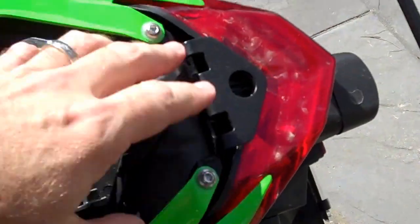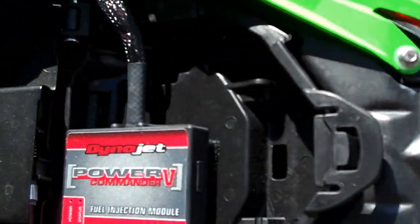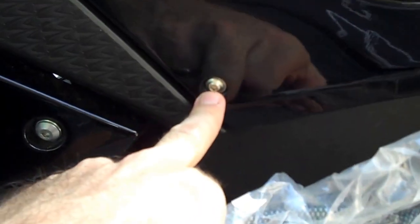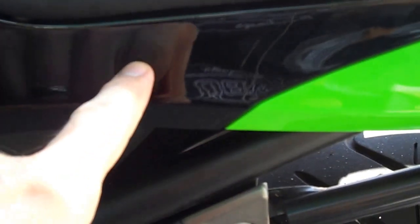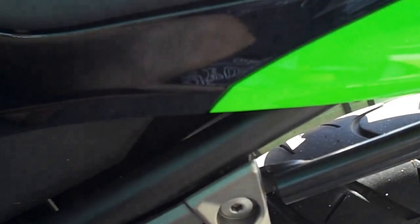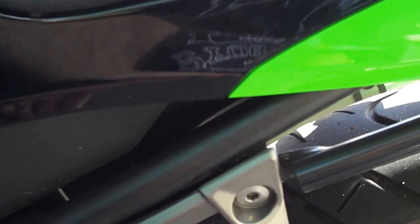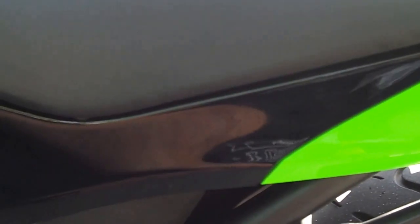It's not hard to wire it up. There's just the anode and cathode wires that come back off the power socket, and you mount those back to the battery. To get to your battery, on the side there's a small screw on both sides — pull those screws out and this cover comes off on both sides. Underneath the seat there's another bolt on both sides that needs to be undone. Once that bolt's undone, the seat pulls straight off. Straight underneath your seat there's a small cover on top — lift that up and underneath is the battery. Just connect your terminals up to the battery and you're ready to go.